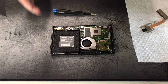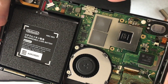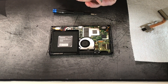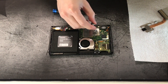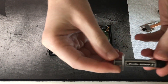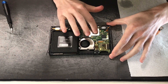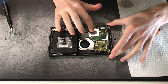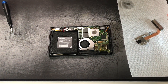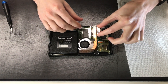Here is the die — you can see where the copper shim used to go, indicated by the little arrows, but I removed it; it's just a very thin little sticker. I'm reapplying thermal paste using Arctic Silver 5. Because this is direct contact with the die, you want to make sure you spread the thermal paste all over it — you don't do it like a CPU where you just put a glob in the middle. You need to spread it to all corners since this is direct die contact, not a shim.